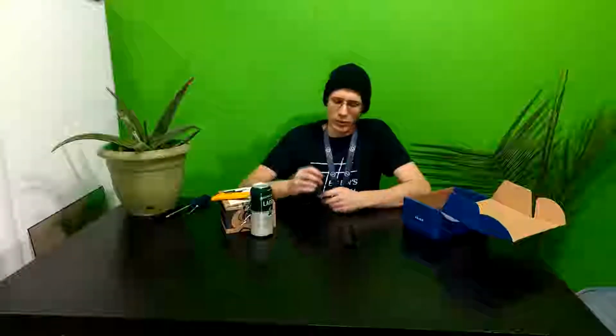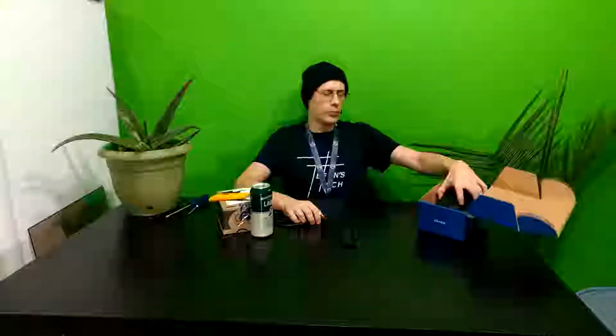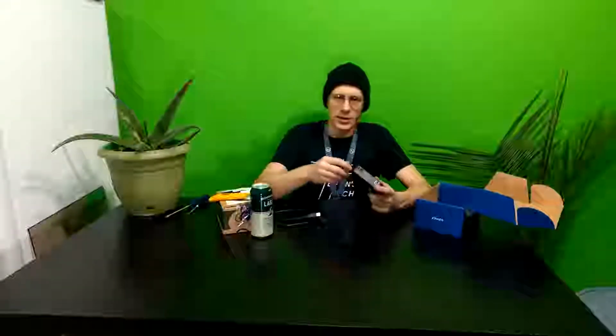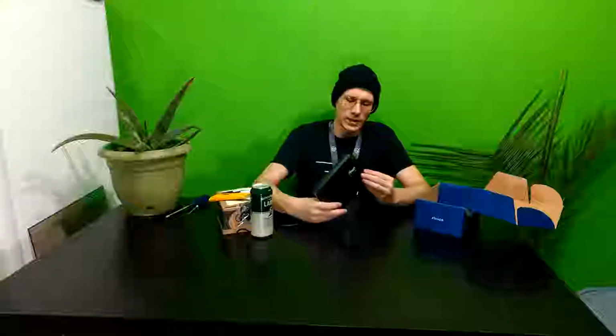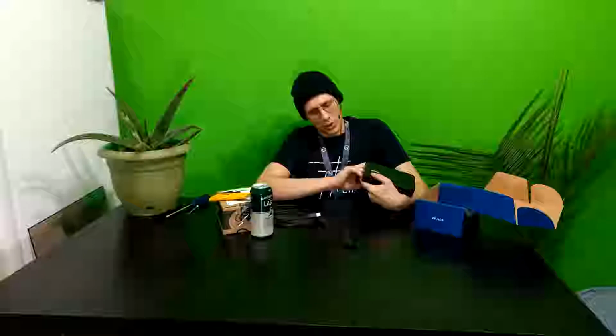So we're gonna test some of that out, and we're gonna use the Crystal Disk Mark program there, eh? And get some results and stuff, and show you the difference between the hard drive just plugged into your computer through the SATA cable, and then compare it to the 2.0 port and the 3.0, and see how much the speed difference is there, eh? And we would put a solid state drive in there, but it's a 3.5 inch enclosure, so I don't think people would buy this intended to use a 2.5 inch drive inside of it.